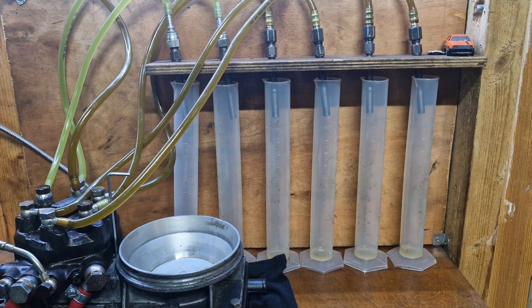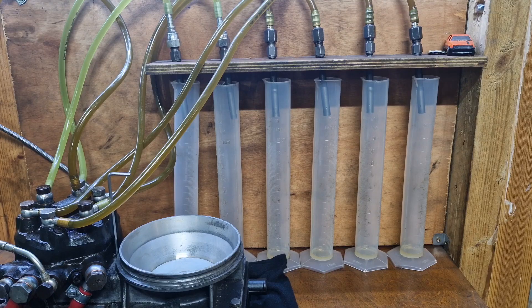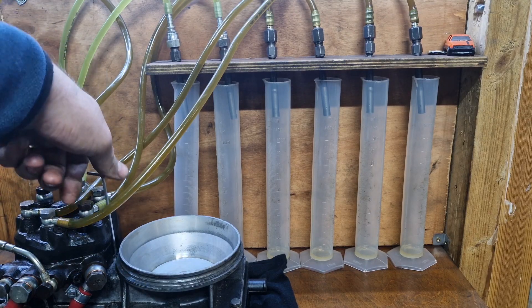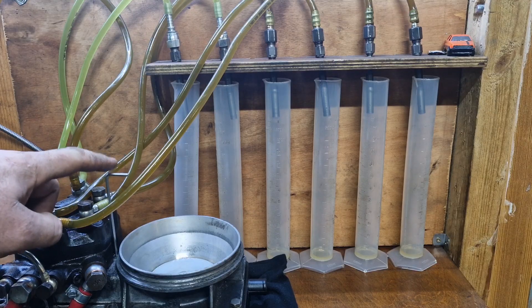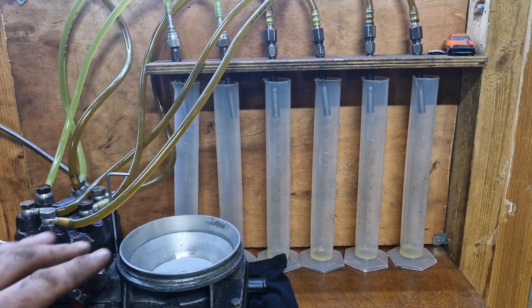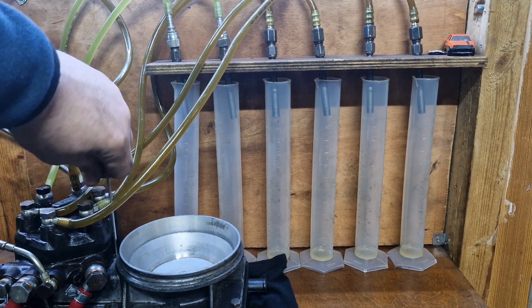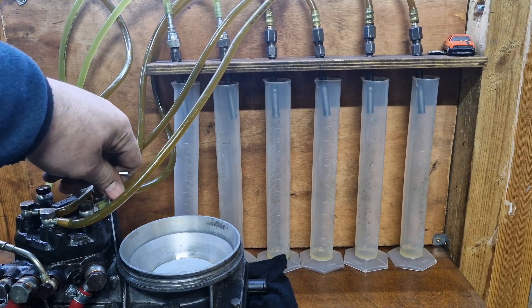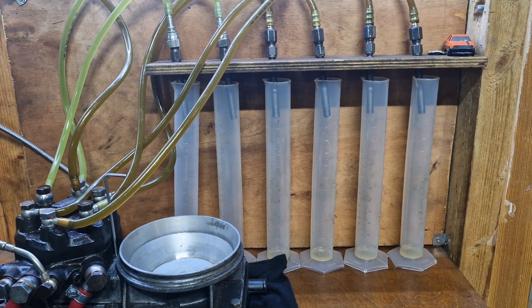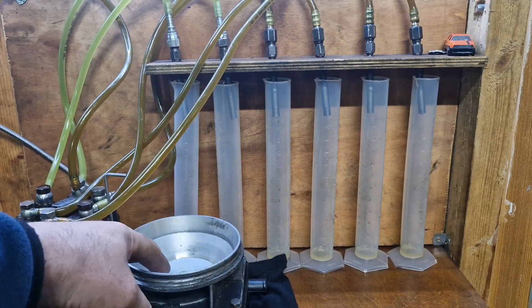What we want to do is turn the screw clockwise - clockwise as you're looking down means more fuel. I'm going to turn that in and run the system up again, looking at the injectors for when they start dripping. Still nothing after one full turn. One full turn on this thread raises the arm about 0.2mm - it's not a lot, it's a very fine thread. I'm going to do two turns to speed things along. There we go - now you can see the injectors are starting to open. We don't want that because the plate's closed.